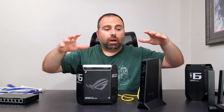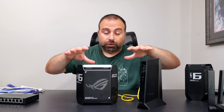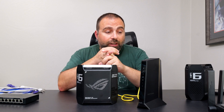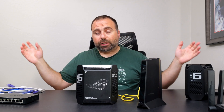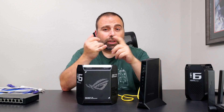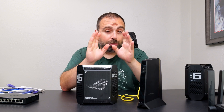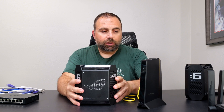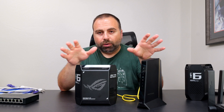So now you're back to technically where you were before you started. If you want, you can pick the same Wi-Fi name and password as your existing router and your devices should automatically connect to this one. Both your Wi-Fi name (your SSID) and your password are both case sensitive, so just as a heads up. Once you get this set up, you are golden.